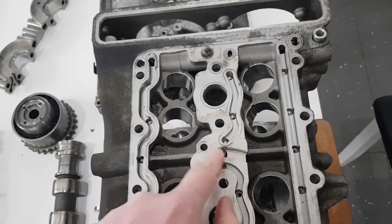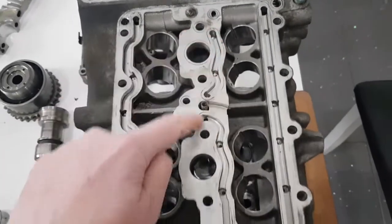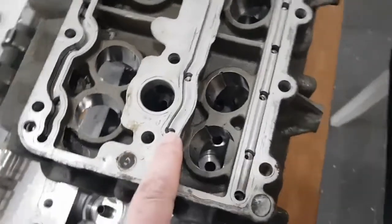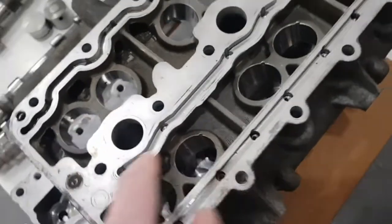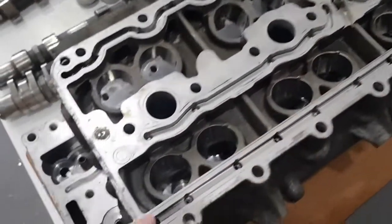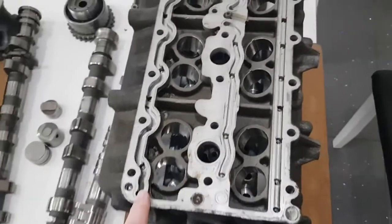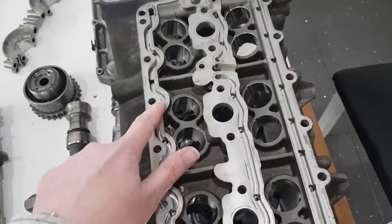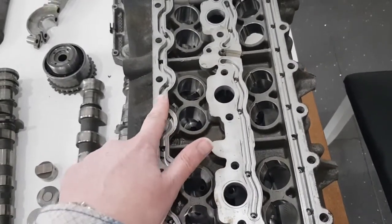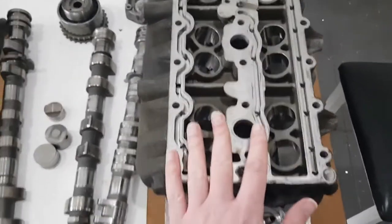In terms of the operation, there's an oil feed which comes in here and there's a solenoid on the other side, which you'll see when I turn it over. The outlet from the solenoid feeds two channels, and there are drillings from those channels through to the tappets. When the solenoid operates, oil is directed into the tappets and pushes the pins across, locking the two sections together. The hydraulic followers are fed from drillings on the exhaust side and the intake side — that's what the channel unused on the GT3 is used for on the turbo.